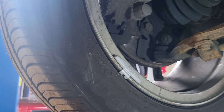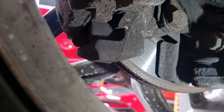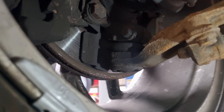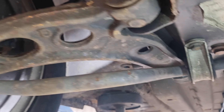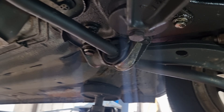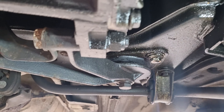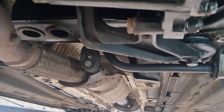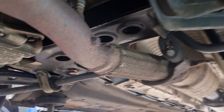You can see the pads at the back again — they have a nice amount of corrosion and a lip to them, so they are going to want changing. The anti-roll bar bushes look okay. We've got some sort of an oil leak around the back here. Let's have a sniff of that. It doesn't smell like gearbox oil, so we need to have a look at that and see where it's coming from.